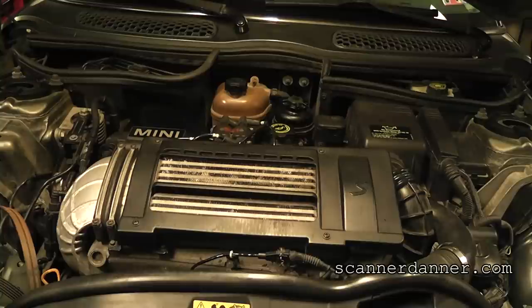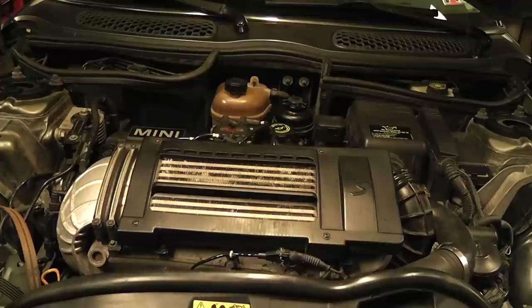I think the lesson here is this: when we have a car with excessive amperage and a crankshaft pulley you cannot turn by hand, you better be thinking about your accessory pulleys. Take the serpentine belt off. Another one I've seen — I mentioned — is a starter jammed into a flywheel on a Volkswagen. The difference with that one is it did not crank at all, just a heavy click, and we had about 700-800 amps on that one. When I tried to turn that one by hand I couldn't, but it ultimately ended up being a faulty starter. We need to think about these things before we rush judgment on a seized-up engine. Showing voltage and current from a battery really tells you a lot about the car. If someone had done those tests to begin with, they would have never put a starter and battery in this car. Really good one — another variable to consider.